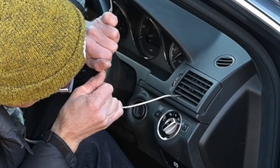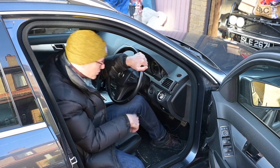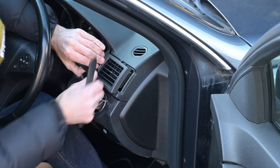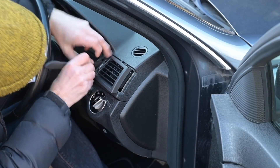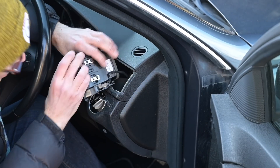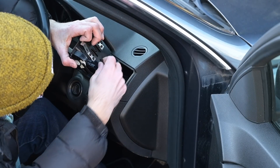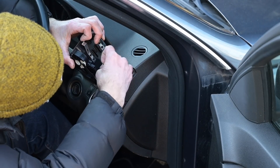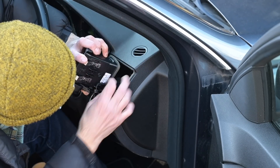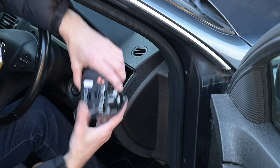You are meant to use two at once, but one does seem to do the trick. Now I think some trim tools will definitely come in handy to help separate things out without damaging anything. There we go — sideways and out it comes, and there is a little connector on the bottom that unhooks from there so it doesn't rattle and get caught or lost. So don't forget to put that back on there when the new one goes in.